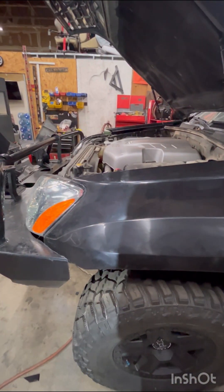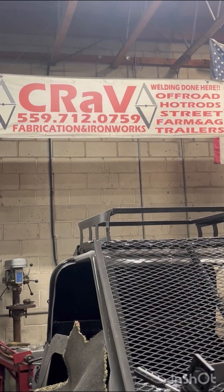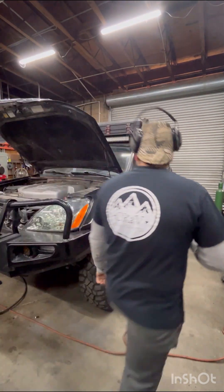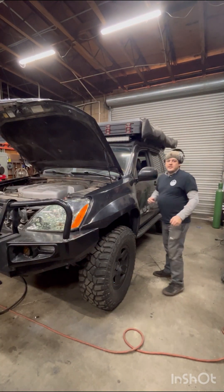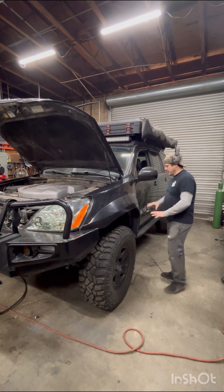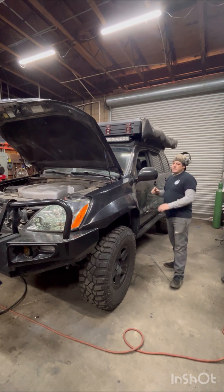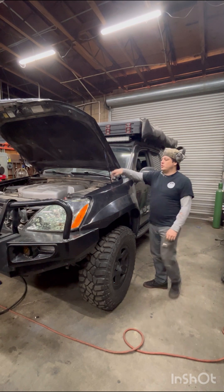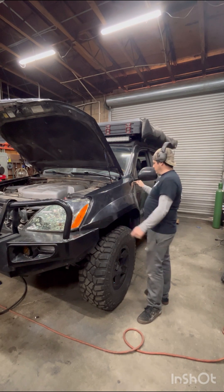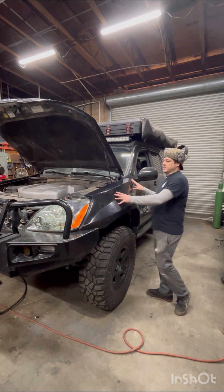I've got to cut the other side too. Alright, be back soon. I've got this fender on — it's all lined up, doors and everything opened up fine, and it all looks good. So I'll be able to drill the holes in the plastics — four up here, two down here, one back here, and then one down there. On this side that makes it pretty simple.